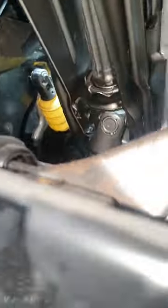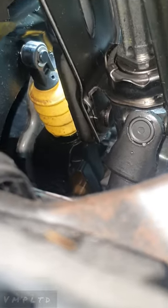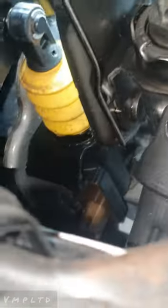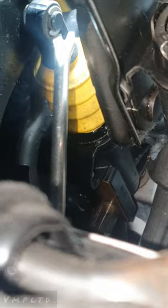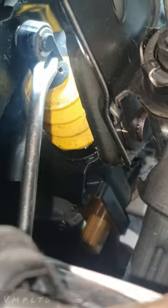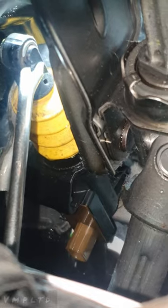The more you do these, practice makes perfect - that's what creates competent technicians. Can you see that yellow spongy thing? If I zoom in to where it pivots on the clutch pedal - you see the yellow spongy thing and then this part here - that pivot is the clutch pedal. This yellow thing and the rest of the moulding is the master cylinder. This little disc-looking shaped thing comes off and is basically going to sit in the groove of the clutch pedal. On my last one this little locking device had already been removed.